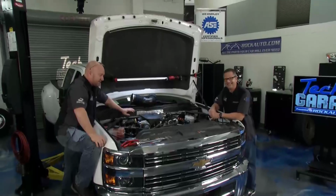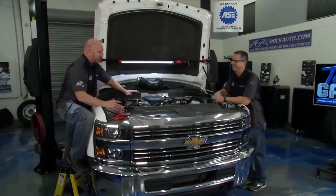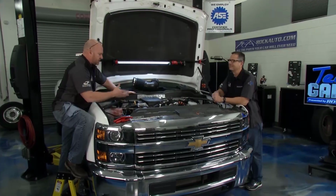Ugh. Well, you know, there's a lot to love about a diesel, and some of it is that maintenance has just got to get done. It's not necessarily pretty and all that glamorous. This appears to be one of those projects, but you said you had some rough starting symptoms and you heard some air sucking. So we're starting with the water fuel separator here. Talk about that a little bit.